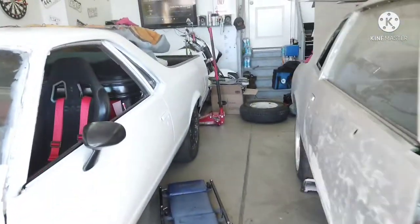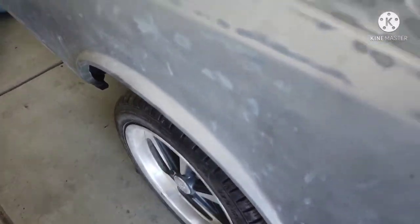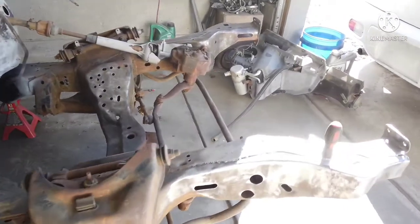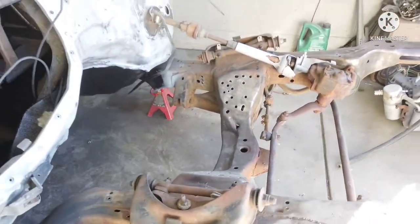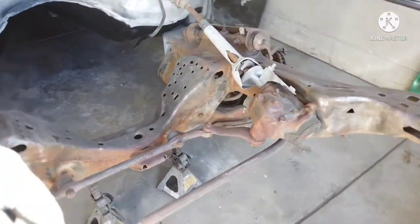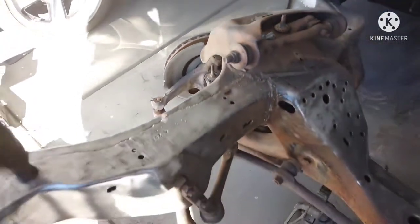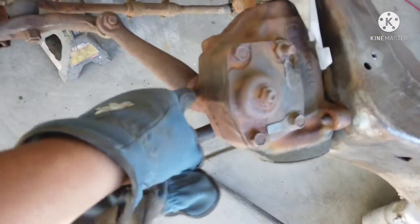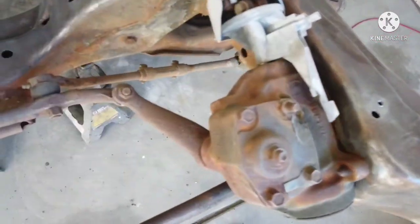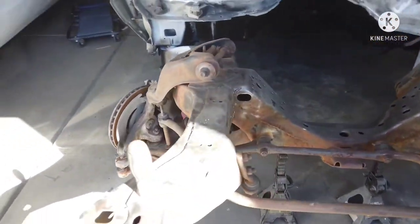Alright, got the tires switched over. It still looks like it's sitting lower — let all this stuff settle in, get some weight in the car. Now going to start pulling apart the whole front end. It's all just bolt-off stuff, you just have to be careful when you do the lower control arms because with the springs in there they might shoot out, so make sure you support those. Other than that, everything just bolts on and off. Take all the steering linkages out — actually, three more bolts and I might as well take it all off.